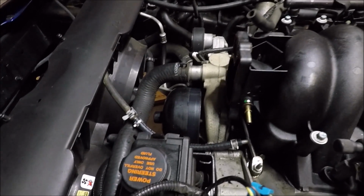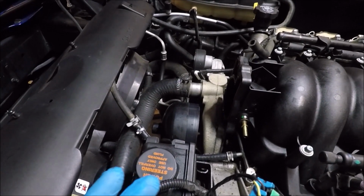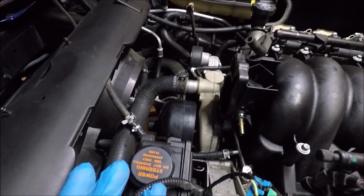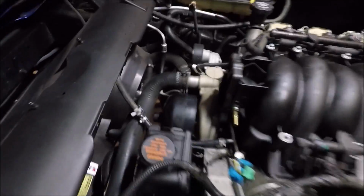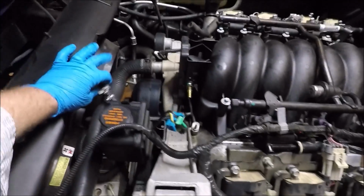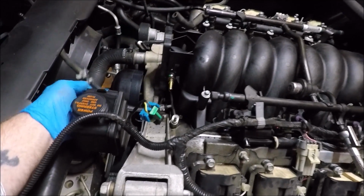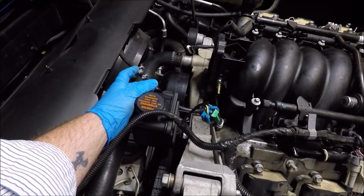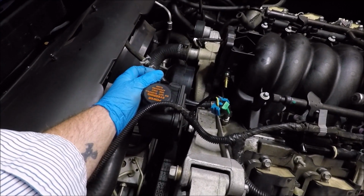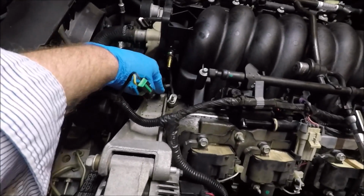Now, this is a real simple modification. I don't know if it's worth anything. To be honest, I'm kind of skeptical, but it does eliminate one more possible coolant leak. So basically all you do is take your factory line that used to run from the radiator to the throttle body, get you an elbow or a 1/4 inch barbed two-way male fitting and another short piece of hose. Tie that together and run it straight here.